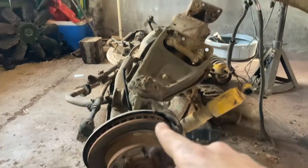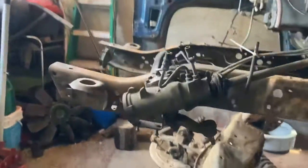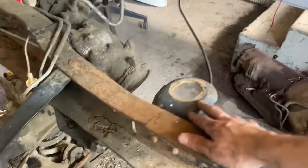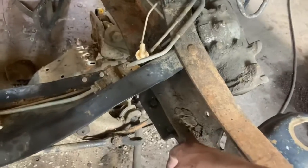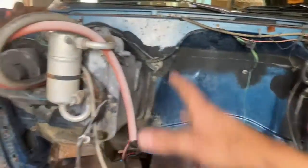All this is no longer attached to that — it's all removed. And now I've got to start removing other things. They're a little harder because they've got the rivets. I don't need the two-wheel drive rad support mounts; I've got some four-wheel drive ones coming. Move sway bar mounts — those are riveted in too. And then kind of clean everything up and mask off what I don't want painted.